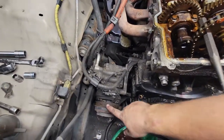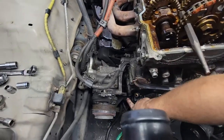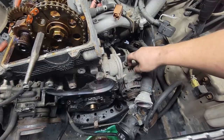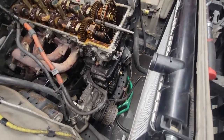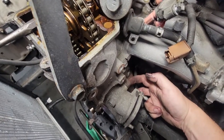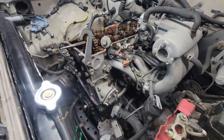You are going to need to take off your AC compressor, which is four 14mm — one up top, two down below, three, and on the back side four. You're also going to have to take off your alternator. When you get your bolts out, you're going to have four 12mm in the bottom going up from your oil pan. I found two more bolts hiding in the back here — one and two — and you have two in the head straight down. I'm hoping that's all the ones that are hiding.